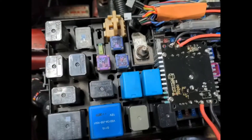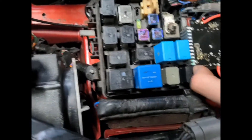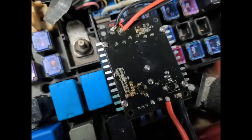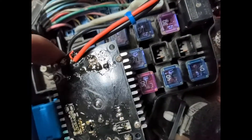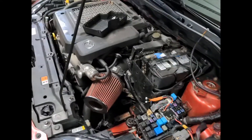I'm shoving everything in the fuse box, and hopefully I do not short anything out. This is the 5-volt regulator that I'm using. It's a bit of a chonker and hopefully overkill, because I'm going to be drawing around 10 to 12 amps at 5 volts, which is a weird electricity configuration. But this thing should be good for that much amperage — we're going to see how hot it gets. I had to trim down some of the fins to get it to clear this fuse, but it looks like I'm going to be able to get everything in here without interference, so we're not adding any unsightly stuff to our beautiful engine bay.